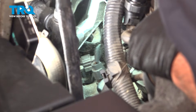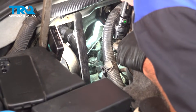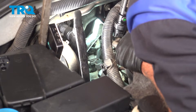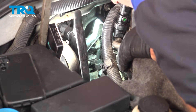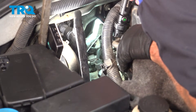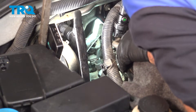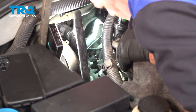There's a wiring harness right beside the sensor itself. If you follow that wiring harness down just a tiny bit on the driver side of that harness, you're going to come across a 12-millimeter bolt. This bolt secures the harness to the back side of the engine. We're using our quarter-inch ratchet and 12-millimeter socket to loosen and remove it. Once removed, you should be able to pull that harness out of the way a little bit and allow us to grab that sensor and pull it out of the engine.